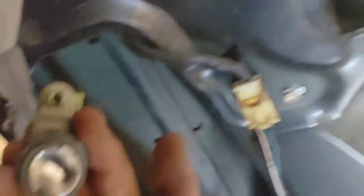This might be difficult for other people because they haven't done this before. This door handle has been removed probably three or four times now, so it's pushed out so I can get to the back of it. They're color-coordinated — this one's got a green lock switch on the arm. I'm just going to move that out of the way. There's the old lock cylinder. As you can see, they smashed it up. The locking mechanism needs to be replaced.